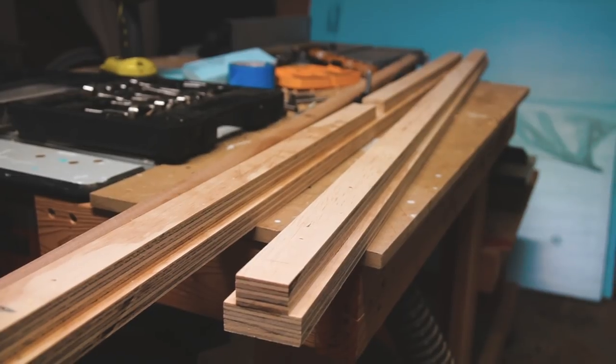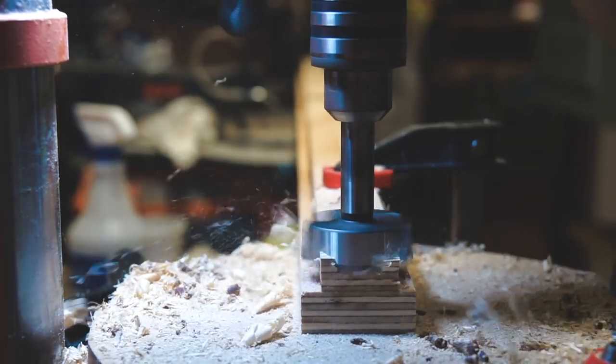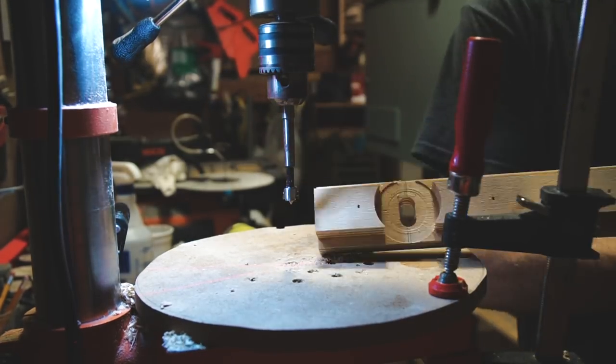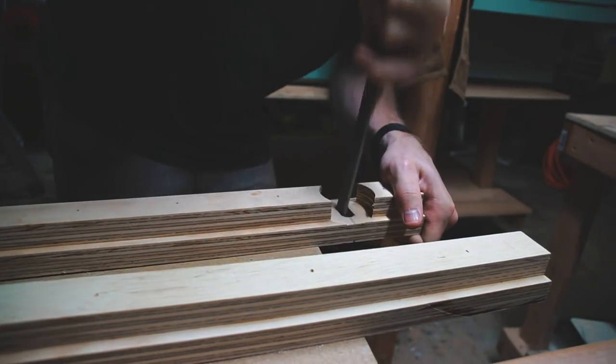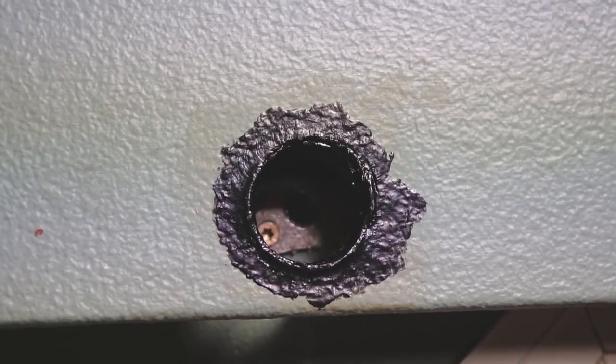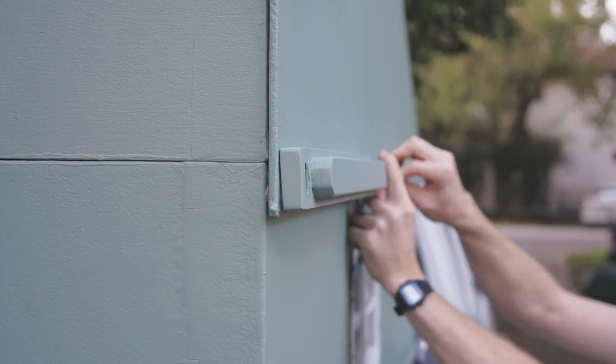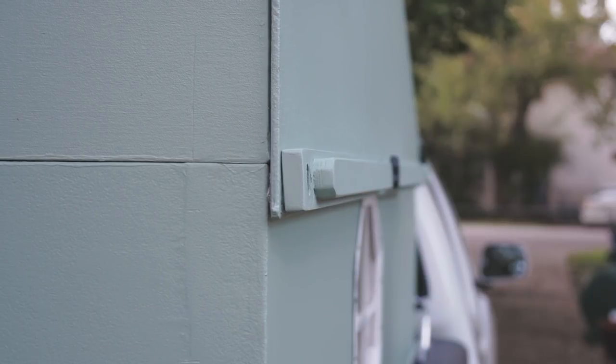What I'm thinking is I'll need to add a rigid piece of material that goes across the whole bottom edge of the wall to evenly apply pressure. For the alignment, I might figure out a way to make the openings bigger. So I glued a couple strips of plywood together, cut recesses where the thumb screws go, used a hole saw to cut bigger openings in the side panels, then sealed up the holes and painted everything to match. Here's how they attach and clamp the sides into place.